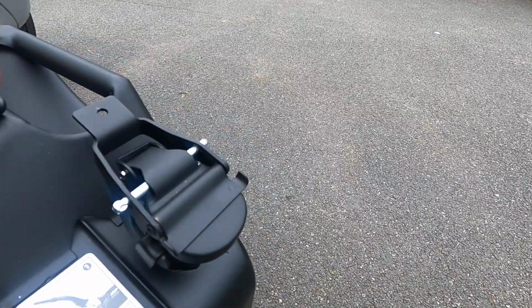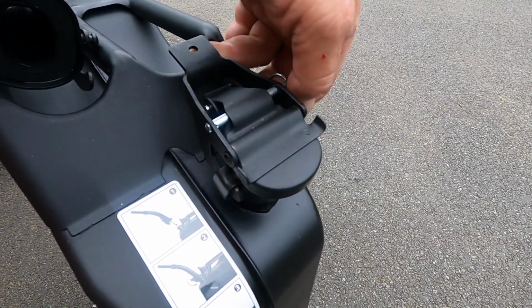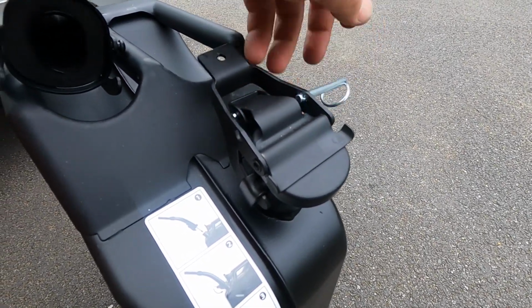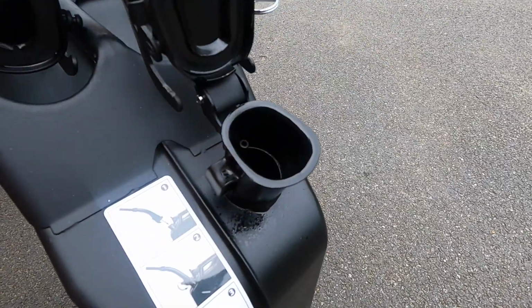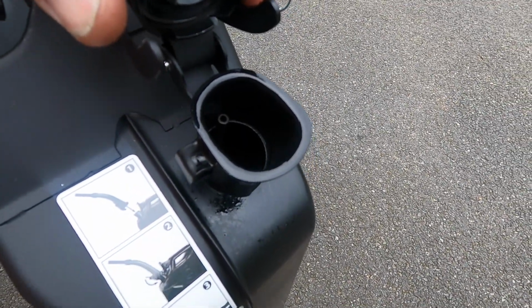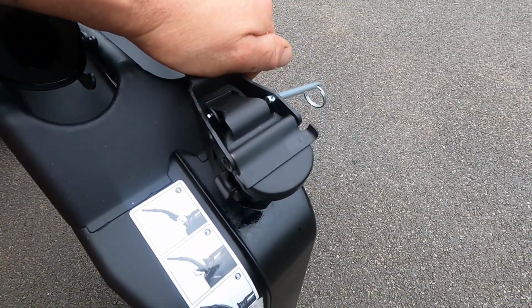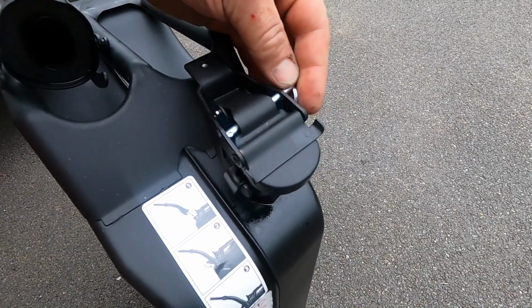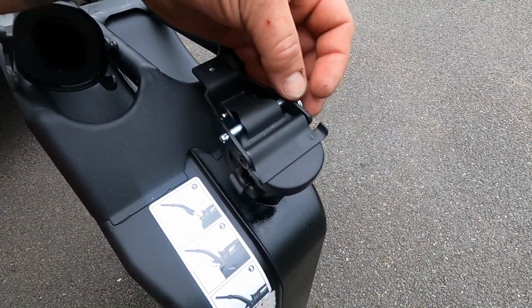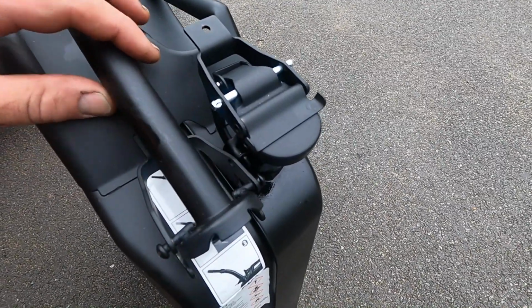And he's absolutely right, because some of them have got really poor coatings which could possibly come out when you pour the fuel out, so you have to be careful, and I would always advise to strain your fuel as you're pouring it out. Put it through a filter and a funnel, big difference. I've had cheap jerry cans before, and yes, the paint does come up from the inside, and that could cause problems in fuel lines later on, so be warned. The expensive ones are much better, but I'm aware of this, and I'm telling you about this now.